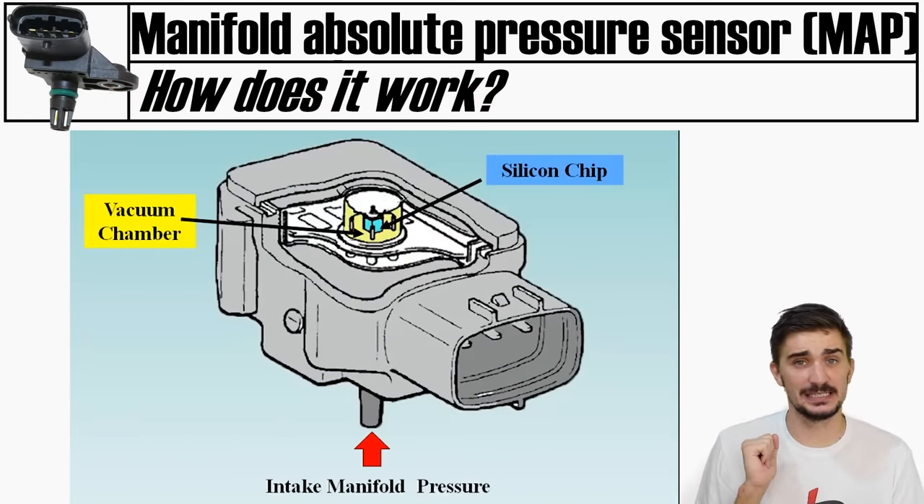On diesel vehicles an EGT failure will cause the vehicle to go into regeneration mode very often and regeneration mode will last longer than usual, with poor mileage and poor performance. NOx sensors measure the amount of nitrogen oxides in the exhaust gases. They are usually only present on diesel vehicles and were briefly present on some stratified-charge gasoline engines. Their main role is to verify correct operation of the SCR or selective catalyst reduction system, which injects ammonia or diesel emissions fluid into the exhaust to convert nitrogen oxides into nitrogen, water, and small amounts of CO2. There are usually two sensors in a diesel vehicle - one before and one after the SCR system - to confirm it is doing its job. A failure will trigger limp home mode in most modern diesel vehicles, along with erratic idle and poor mileage.